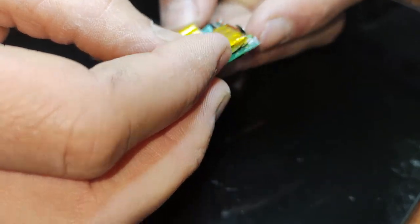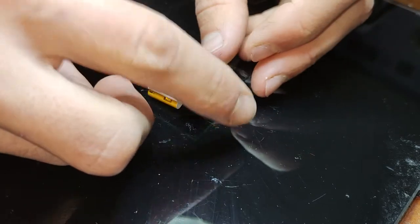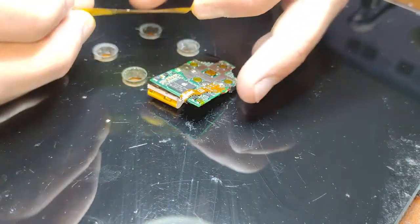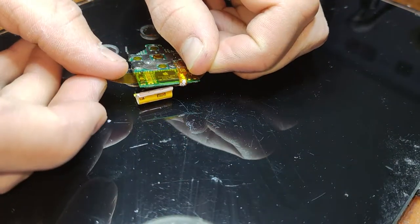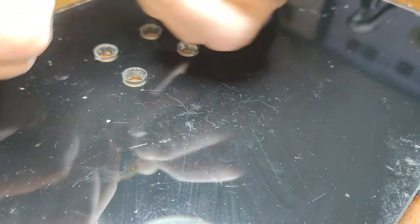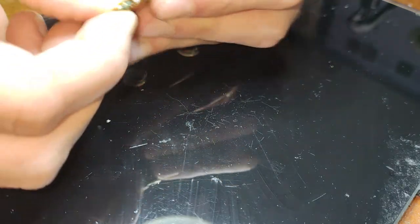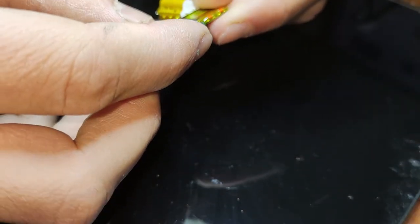So when you get them, just when you first install them, just plug them in and charge them up to 100% straight away. That's usually the most healthy thing you can do for a new battery. Because if you just drain it from 50% all the way down to zero and then don't use it for a month, that can be pretty bad for the health of the battery. That can do some long-term permanent damage.